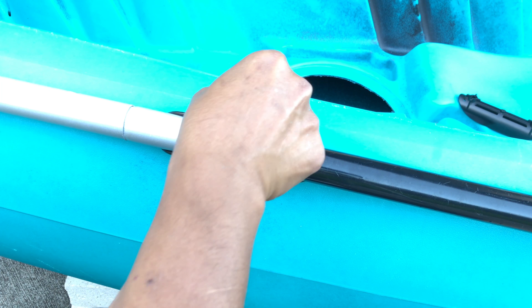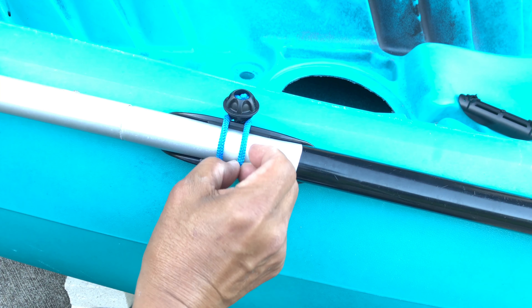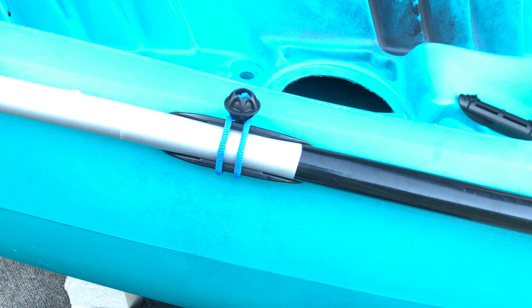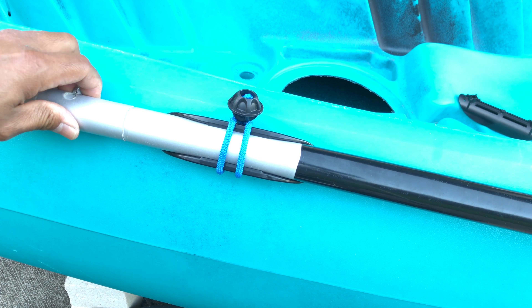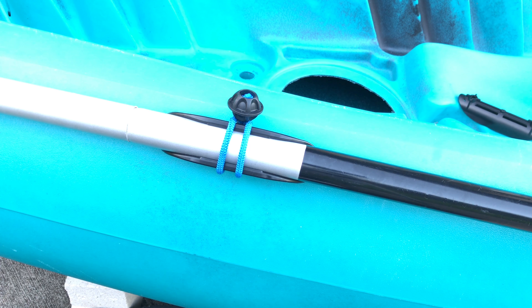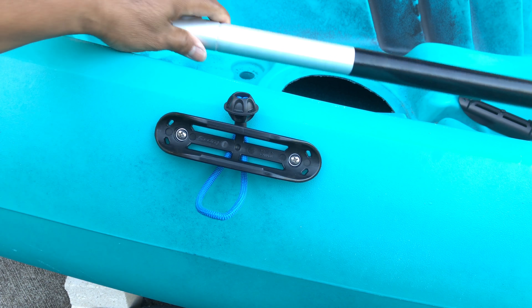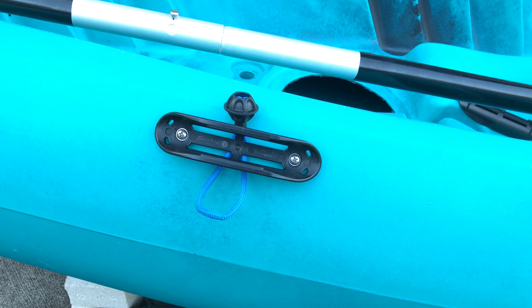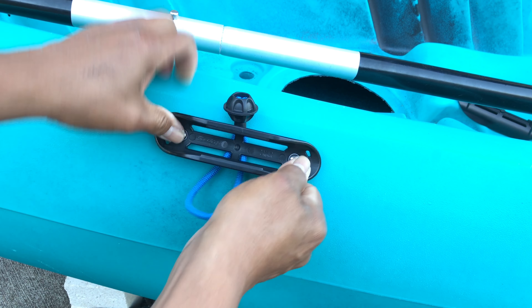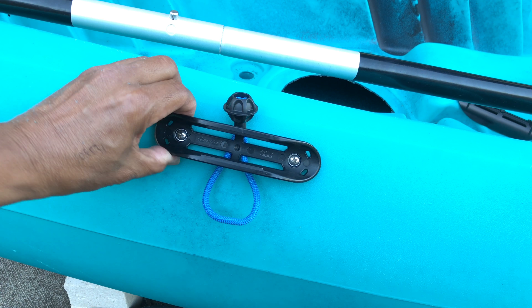For when I'm transporting the kayak in the back of my truck, I put these on to make sure — if they do pop out, these help them stay in, and if they do fly out, hopefully this will hang on to the paddle. I'm pretty confident it will help hold it in. So if you're thinking about installing one of these paddle holders, I would recommend putting a backing plate behind it — a pretty good size one — or big stainless steel fender washers to help support it. No rivets, no self-tapping, just machine screws and a backing plate — that's solid.